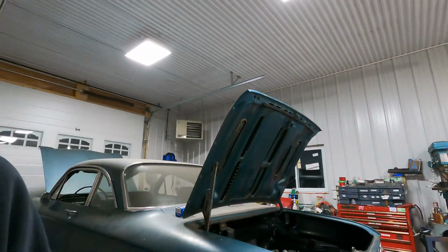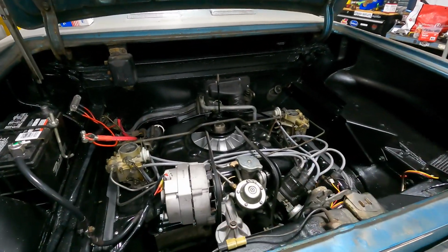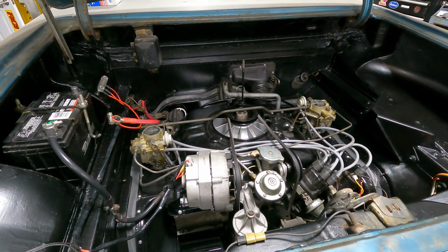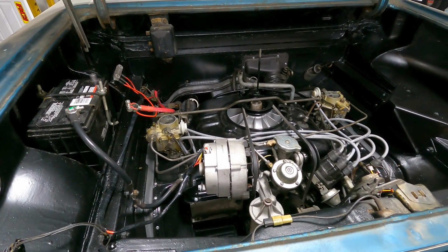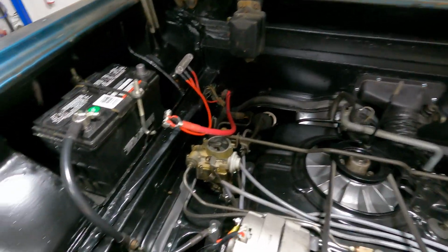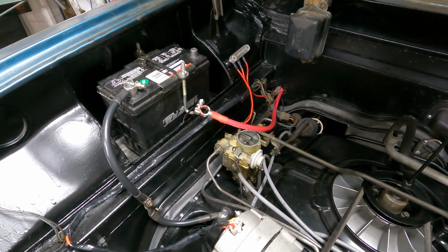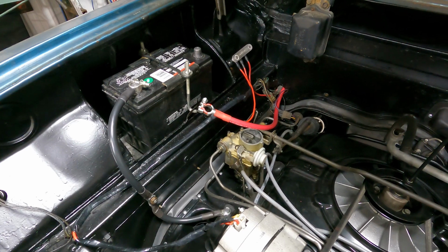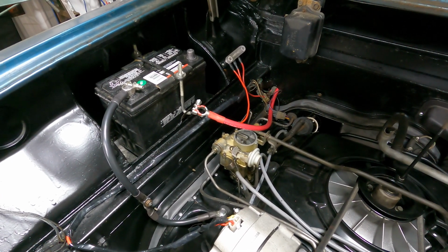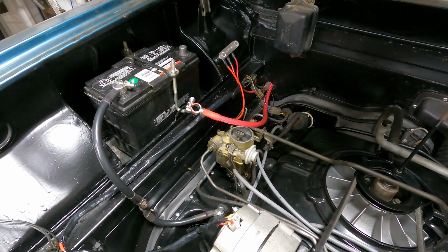As you saw in my last little clip, the engine's in, but now all the wiring is done. I have run it, it does run. I made some ground cable and a starter cable, all entirely way too big, but I'd rather be big than too small. I think the stock one is number 4, and this is number 1, so that's quite a bit bigger.